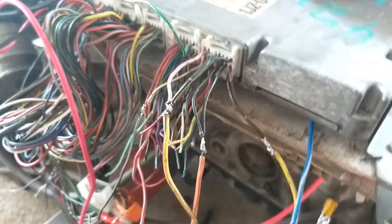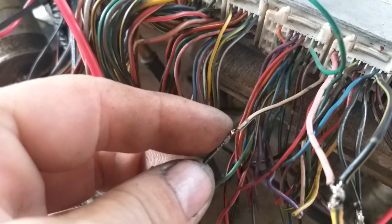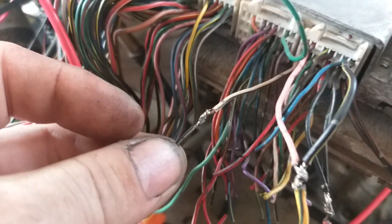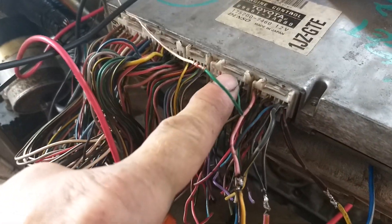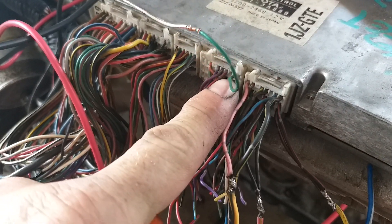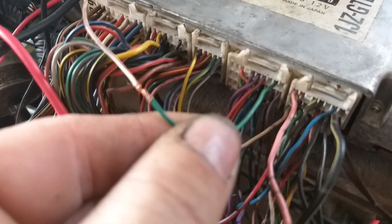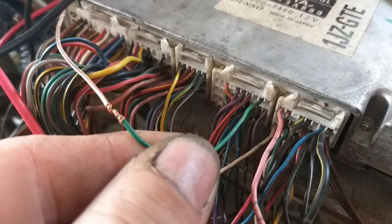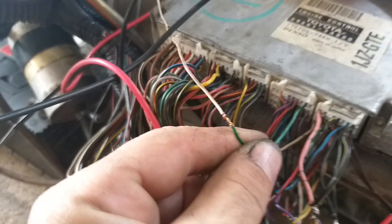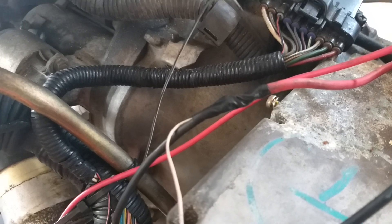So that's pretty much that. And then over here on the bottom left hand corner of the last plug, that's an earth wire. And there's one other wire on the second plug in - don't know if it's important or not but it's supposed to help starting. It's that green one, second one in from the right hand side, top row. Supposed to connect that one up to your solenoid cranking wire - supposed to help it start.